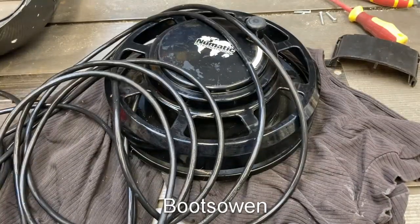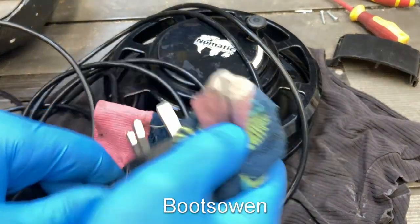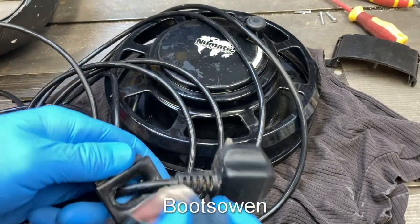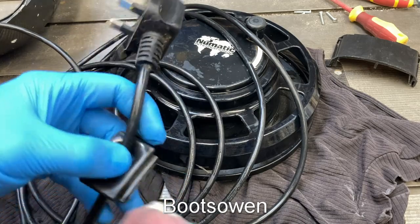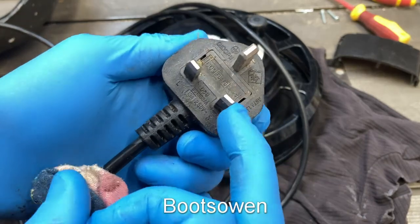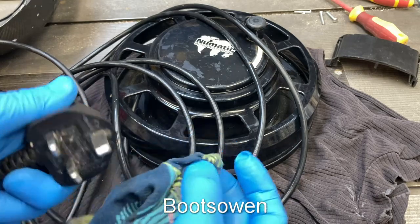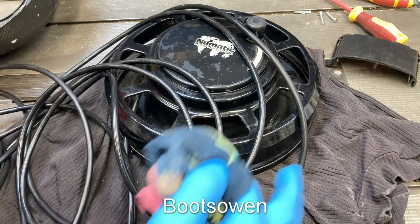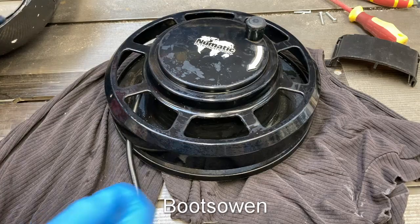There could be any number of faults. What I've seen recently - broken cables mostly, the last one had the cable fail internally at the plug. I've also seen quite a few failed switches recently. That plug pin is bent - that's an issue, that could be it. Sometimes when you're cleaning things you get to know them, get to see what's going wrong. Cable, you're going back on the floor.